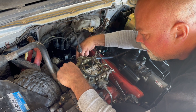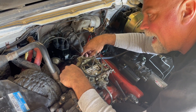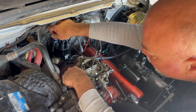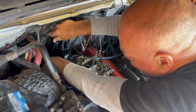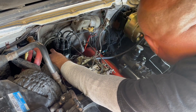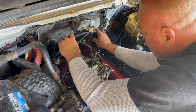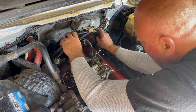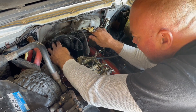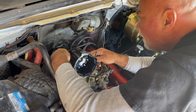You can see that my trap door to the points is facing toward the carburetor pretty much straight on, which makes it very simple to see where to start when I put it back together. Now we're going to remove the distributor cap. You've got these screws in the back — push them down and turn them about a half turn and you'll see it pops up. Do that to both sides, and the distributor cap should just pop straight off. I'm going to move some of the wires out of the way to get everything clear and give the camera the best angle possible.